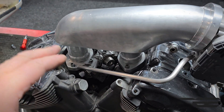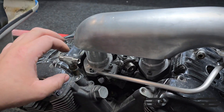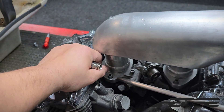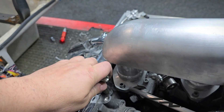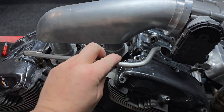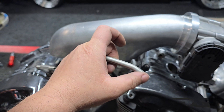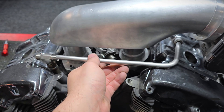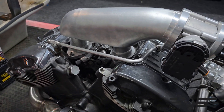I sort of jumped the gun — forgot to record it as per usual, just like getting things done. So what we've done is made some adapters. We're using Swagelok fittings this time — they're a little bit more compact than the AN fittings and they'll withstand a heap because we've got to drop past the exhaust down the front. I machined up this one here, it's got a little o-ring groove — it goes where the factory breather is on the block. Here's the hard line we made: as you can see it angles three different ways — three different angles — and it'll fit pretty good once it's all on. Just need to put the ferrules and the nuts on and that'll be that done.